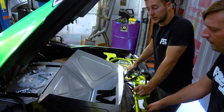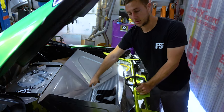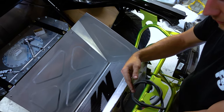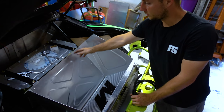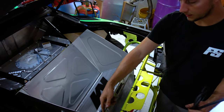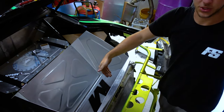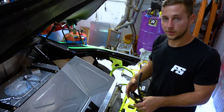We've got all our rear shrouding finished for the radiator. We're going to put a thin rubber hose along the edge to make sure the fan shroud doesn't rub into the radiator — once you grind through those fins you basically have to throw the radiator away. We got it secured to the upper portion of our fuel cell cradle because the angles worked out perfectly, so no additional mounting brackets were needed. We also have a piece that matches the contour of the trunk to seal it airtight, so air passing over the car gets pushed down to the radiator. The fans will do 99% of the work, but every bit of extra air helps.